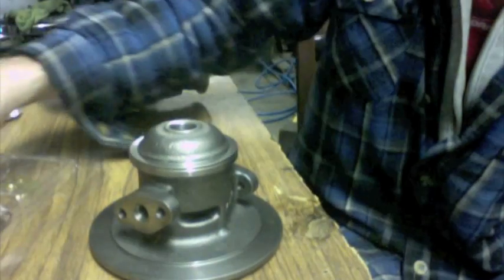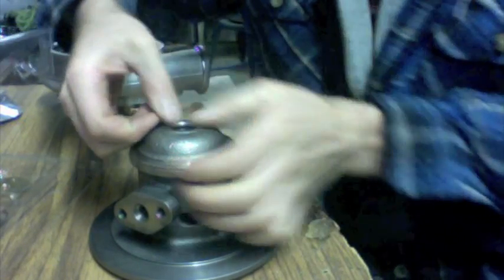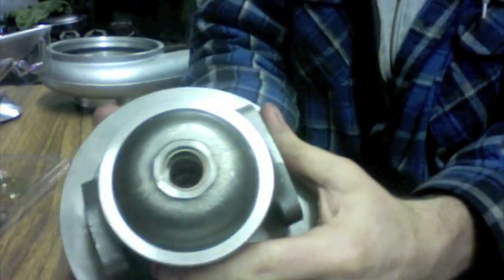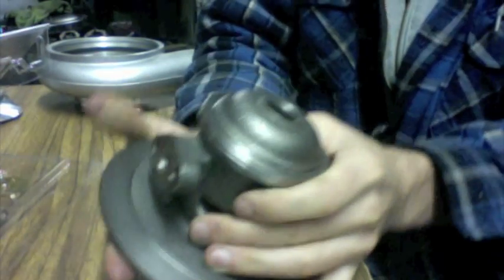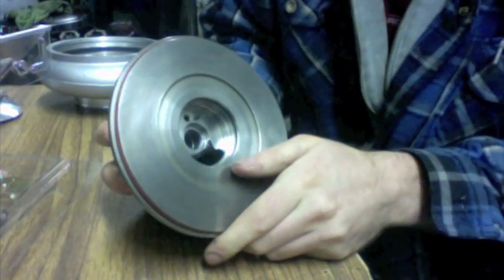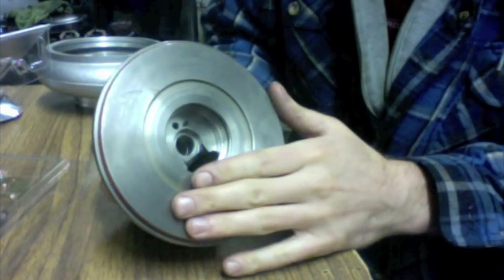The first thing you want to do to make sure that your bearing housing is still good is to take the rear seal and put it in the back of it and make sure that the gap is very minimal, just like in this video. Once you confirm that the gap is still good, then you can go ahead and finish with the install. Another thing to check is for scarring of the bearing housing. If there's any scarring, it's good to go ahead and replace the bearing housing, which we also sell a replacement for.